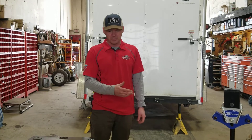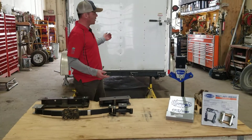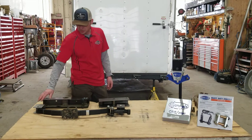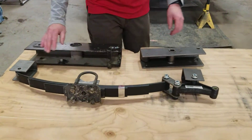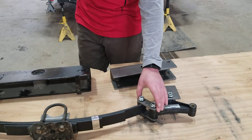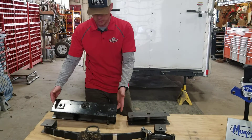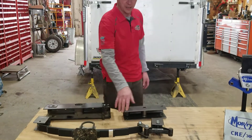We do service complete suspensions here at Factory Outlet Trailers. I like this trailer behind me — we've got a 3,500-pound leaf spring suspension underneath there, 7,000 pounds in total. This is generally what you're going to see underneath your trailer: your leaf spring, your two hangers, generally an equalizer, your shackle straps, and all your bolts. Then you've got your U-bolts. There are different applications for heavier trailers, and this is also an equalizer as well. You can see the different sizes, but they generally do the same thing.